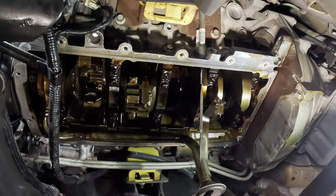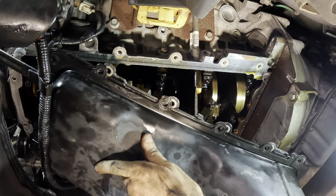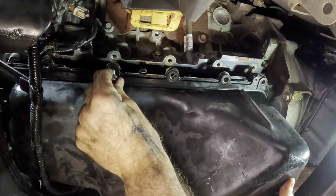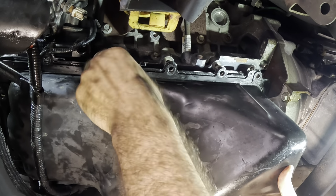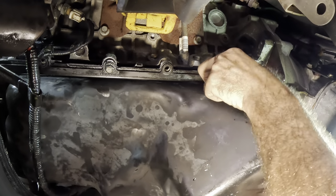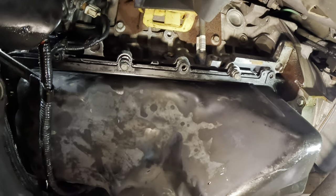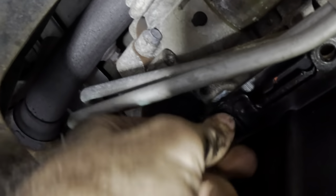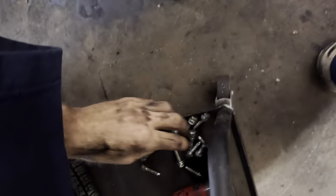Okay, pan's coming in. Gasket is sitting on top of the pan. We need to squeeze it under this piece of wiring harness here. Slide it up into its approximate position. And I'm gonna put one bolt in on this side, actually two, just to kind of locate the pan so it's not at an angle. And then we'll go around the other side, hang two more bolts, then we'll run through and put the remainder of them in. There we go. And then we'll torque them all down to specified specifications. I'm taking care to not push this thing all the way up against the sealant because I don't want to smear it around just yet. More fasteners here.